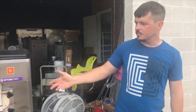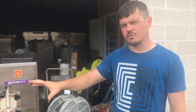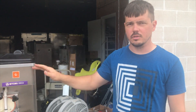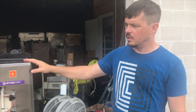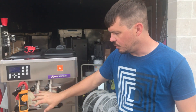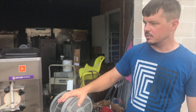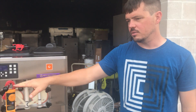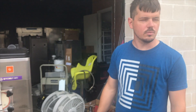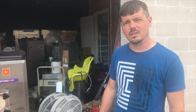So what we learned today is that this machine does run on a single generator. It will not run on that single generator with the eco throttle on — it has to be in the off position — but it runs far more smoothly with a dual generator setup. These machines do take quite a power surge, especially when we pull the middle handle and both beaters kick on at the same time. We were trying to stress test it as much as we could, but the two generators handled them flawlessly. A single generator did handle it, it just wasn't as smooth. You can find more information like this at slicesconcession.com.